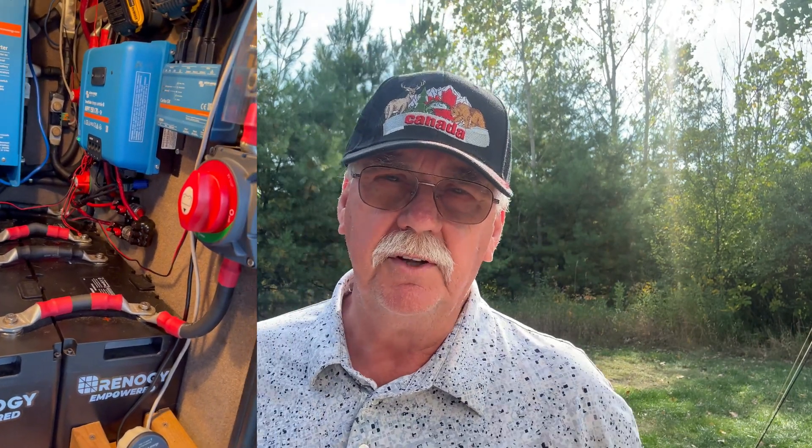That's great, but when you switch your house batteries to lithium ion, those batteries run at a higher voltage and have a lot more amperage capacity. When you go to charge them from your chassis batteries, it takes a long time because it's such a large battery bank. In our case we switched to 800 amp-hours of LiFePO4 — lithium iron phosphate, not lithium ion — they don't burn. The problem is, when your house batteries are low and the two sets connect together, there will be a long, hard draw on your alternator while you're driving, and that could damage or even burn out the alternator.